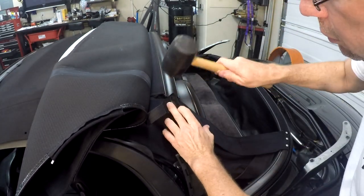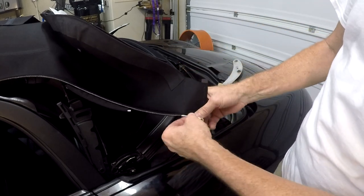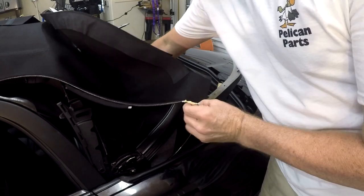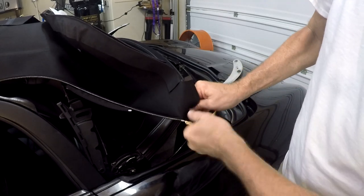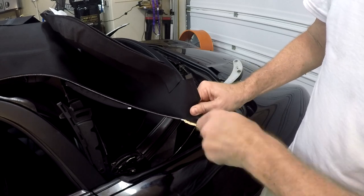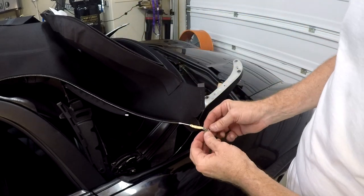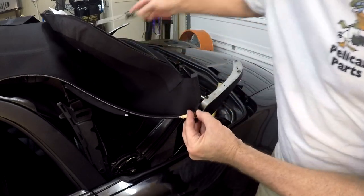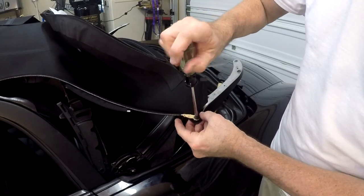With a little rubber mallet encouragement, the next thing we have to do is attach this cable to the side of the canopy. Take an awl and start poking a hole here — stick the awl in a lot further than you think you need to, because you're putting a fairly fat screw in there and it won't get started unless the hole is big enough. These holes were a little too small so I drilled them out a size bigger. Now we jam that in the hole and use the T25 to thread it into the neoprene and canvas.